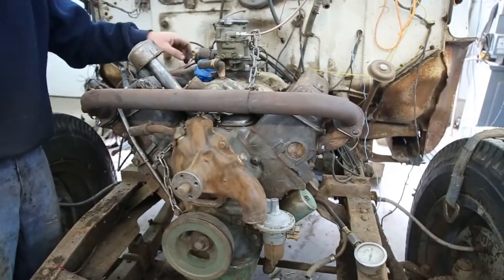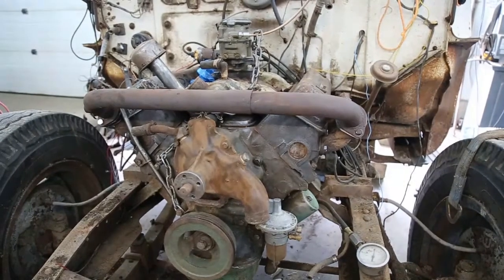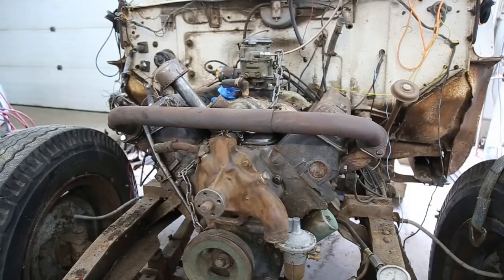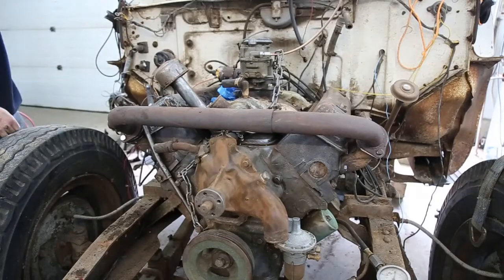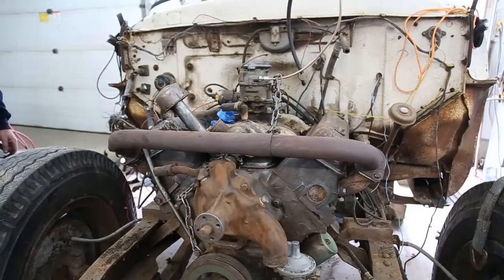So we know our bearings are nice. That's a really good sign. If we started it up and it was less than 30, then we know we have issues. So it appears to be a good engine — yep, 100%. Perfect — didn't see too much blue smoke, no blue smoke at all. It'd be a haze inside the shop with blue smoke, and there's none. It's perfect.